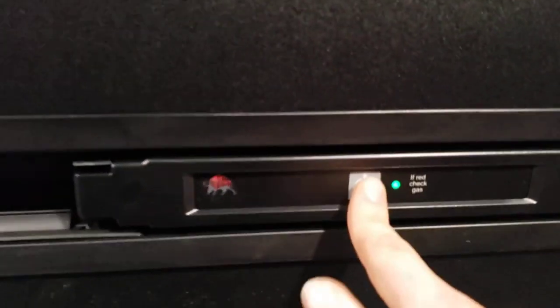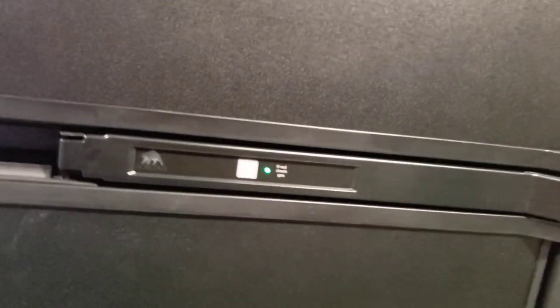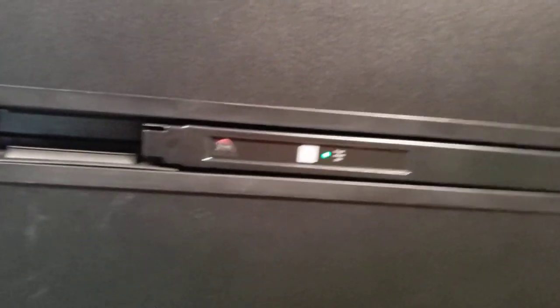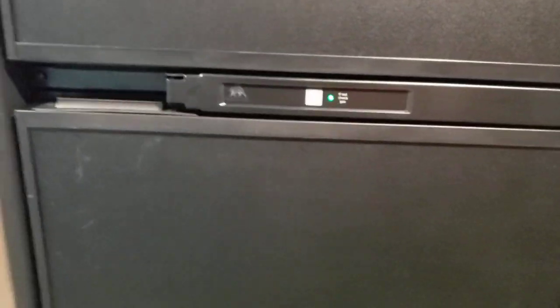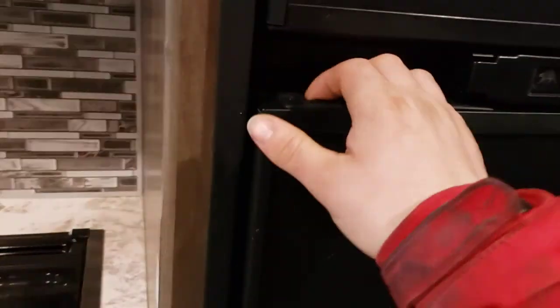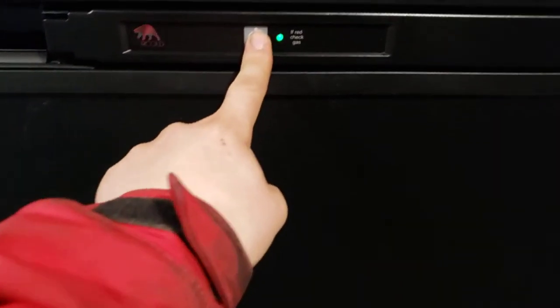Fridge is super simple — you have one button, on or off. Its only mode is automatic. So if it were to lose power — if someone tripped over your plug or the campground lost power — this will automatically switch to running off of propane if you have your propane on. These do not work like your fridges at home; they actually take anywhere from 9 to 12 hours to get to operating temperature. So keep that in mind. Then you just push and hold to turn that off.